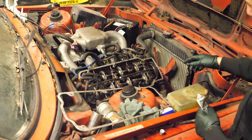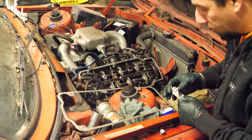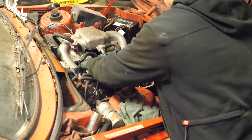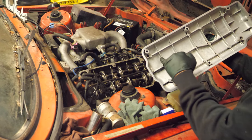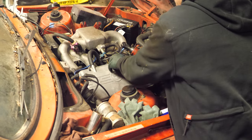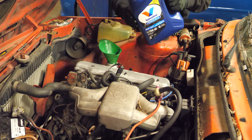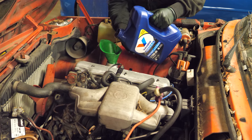Before we go on with the valve cover, I'm going to put a little RTV between the timing cover and the cylinder head — that's the only place you need RTV, just a little dab where the two machine surfaces meet. Time to put the valve cover on. I ran it through my parts washer — it's not perfect, there's a little stuff in the corners, but if the parts washer didn't get it the oil won't break it down either. I like using diesel oil in these old BMWs — some 15W40. This oil shouldn't be in here very long anyway. I'm hoping whoever buys this car changes the oil after a few hundred miles because this thing sat for a while. I went ahead and put a bolt and nut on this bracket so it's not bouncing around anymore.